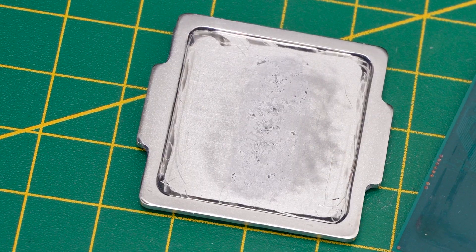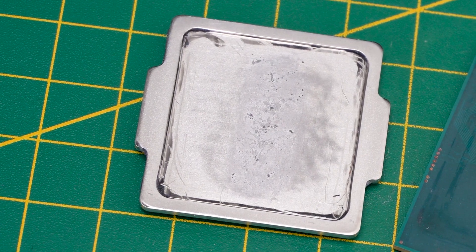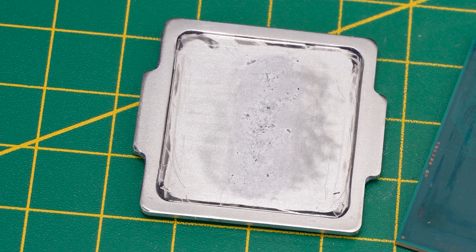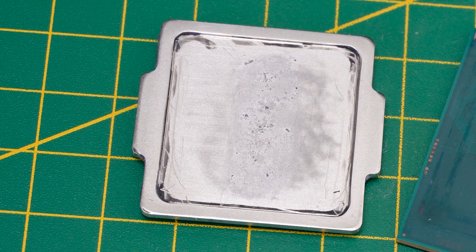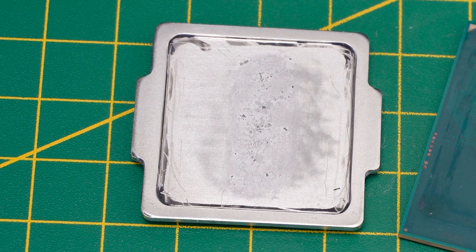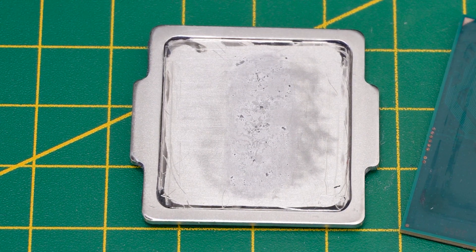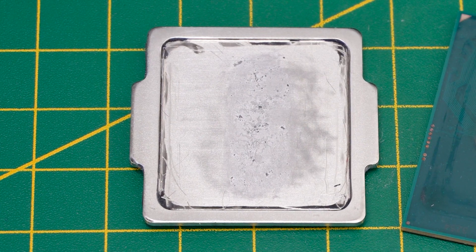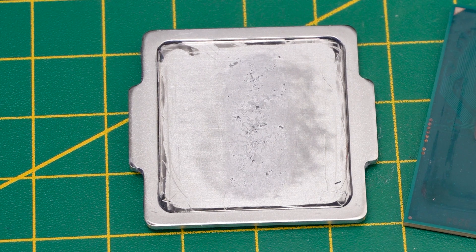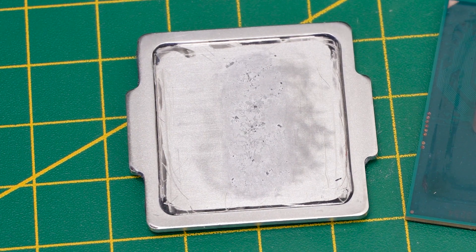In this shot you can see what I mean — right up close to the CPU you can see all those little pits where the CPU die was contacting the heat spreader. It's not major and I'm not that worried about it, mostly because it's easy to pick up a cheap Celeron or Pentium of this era and use the heat spreader off that if I was really concerned. This is after two years and it hasn't eaten through the heat spreader — it's just made a few small pits. The trade-off is the reduction in temperatures over those two years was well worth the cost of this heat spreader. With the water cooler the difference was dramatic when I first applied the liquid metal — temperatures plummeted. So I still think it was a good decision to use liquid metal, but at some point I might have to replace this heat spreader.